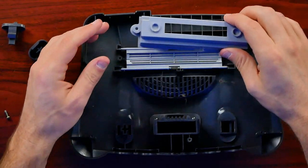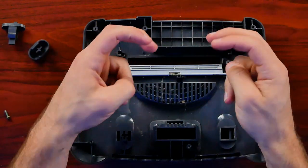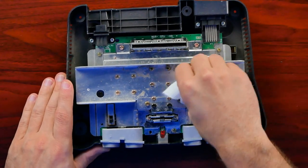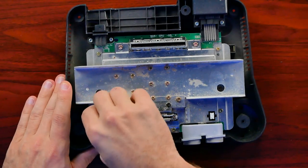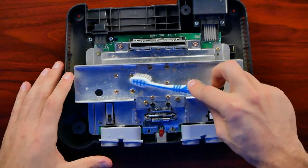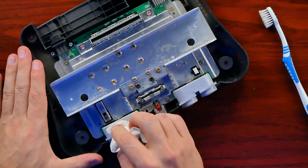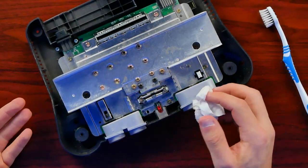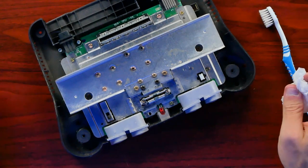The cover is just screwed in with two screws. I'm removing it because there's a spring inside, and I mostly want to clean the plastics with soap and water — I don't want to dump screws and springs in there. You can also remove this completely to play Japanese N64 games, since the region lock was just different plastic tabs, not electronic. For the heat sink, I'll wipe away obvious surface-level dust, then spray some isopropyl alcohol on a brush and scrub it out. These older systems are very easy to clean — just a couple of screws to remove the shell.